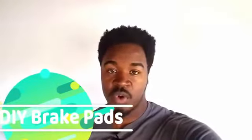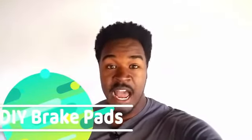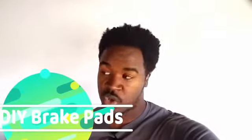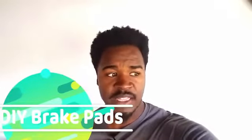All right, so hope y'all are doing good today. Today, I'm going to be changing out some brake pads on, let me get more lighting, on our 2008 Nissan Quest. So this is going to be like a DIY video for those that want to know how to do it. So y'all can stay tuned so I can show you how I change out brake pads, okay? I think pretty much what you're going to need in here is a socket wrench set, and a C-clamp, definitely a jack, with the jack stands for protection. It's going to be that simple, so stay tuned.